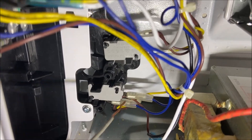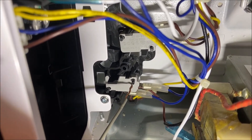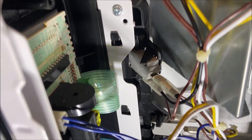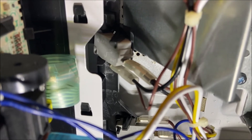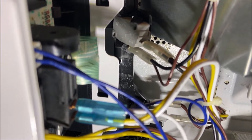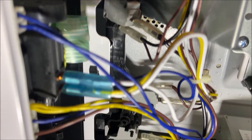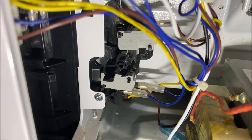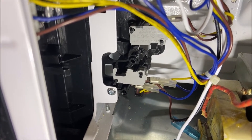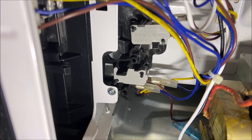These three gray items are your door switches: one down here at the bottom, one in the middle, one up at the top. They're probably positioned a little bit differently for every microwave brand, but in general it should be about the same. We have those three switches so you just need to find them, and they all come out on this microwave pretty easily — that's probably true for all other microwaves as well.